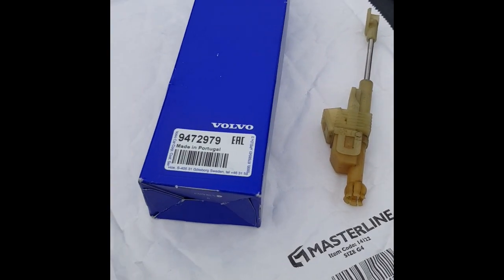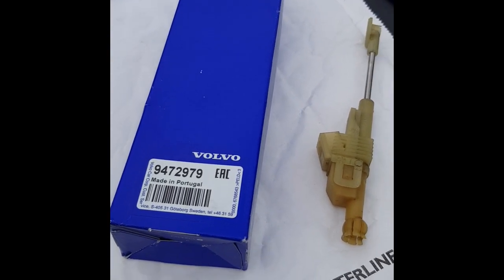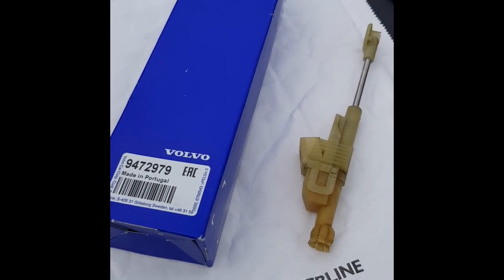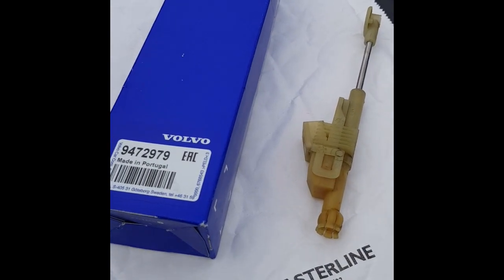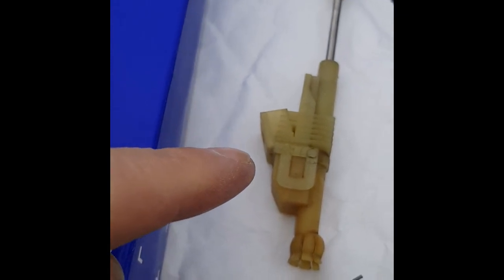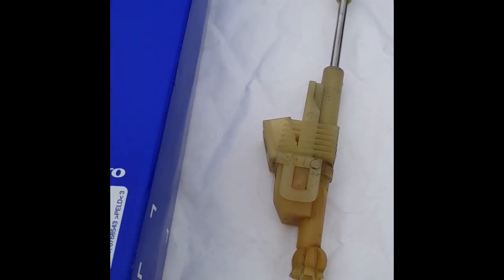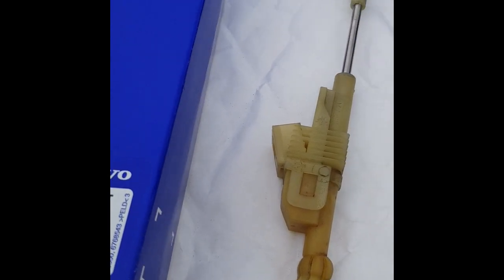Cleared the OBD code — it's all gone. I'll put a still of it on this video to show you what it is, and that's what cured it. It's only 200 ohms out on the bottom of the scale, but that's enough to fool the ECU into thinking it's broken. All I've got to do is put the cover back on and get under the pedals, and that's going to take me longer than it did to change the clutch position sensor. Hope you find this helpful. Thanks, bye.